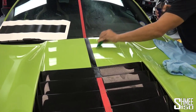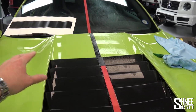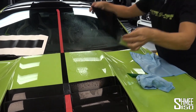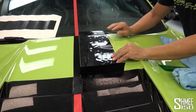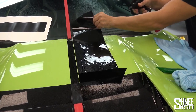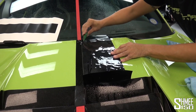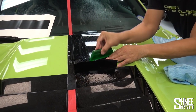This is on top of the PPF that's on the hood itself. It's applied on the wet surface, moved exactly into place up against the central line, which will of course be peeled away later on. Here we have the Altered Black PPF, which shuffles into place before being applied with the fixed solution underneath to stick it down — and obviously with the benefits of PPF on top, and also the self-healing capability so it won't scratch up from light surface scratches that you get with cleaning out on the road. And it will look fantastic with that proper paint-like finish.